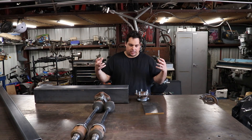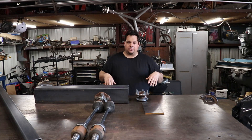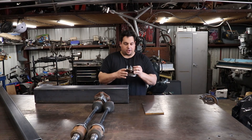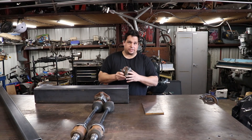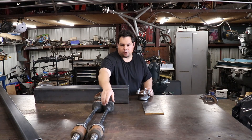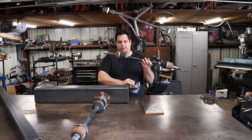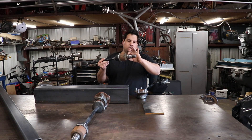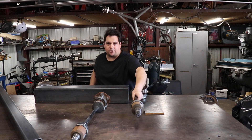I'm going to have a De Dion axle. The De Dion axle is basically what's referred to as a dead axle — basically like having a straight axle with leaf springs and all that. But then it has independent-style axles going to it with a hub, with a micro stub hub that I'm going to be using. This is actually off the Model 3 — a Model 3 micro stub hub, very similar to a Chevy micro stub, which you'll see on a lot of off-road cars. This is a stock Tesla axle off the Model 3 which works with this hub. Luckily, this end actually goes into the Model S motor — it's the same spline, same shaft. The only thing different is this end is smaller on the Model 3, and this is where the seal rides. So all I have to do is change the seal on the Model S motor to a Model 3 seal, and those will work.